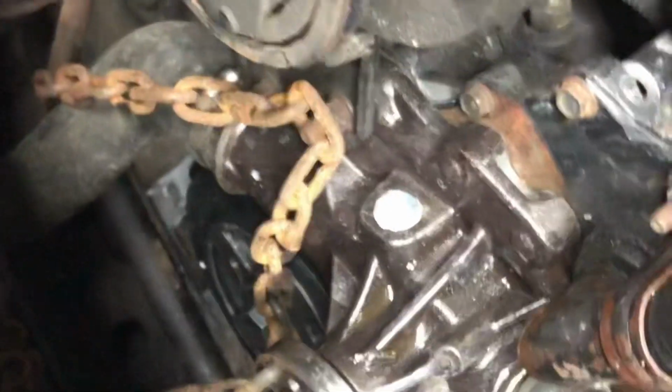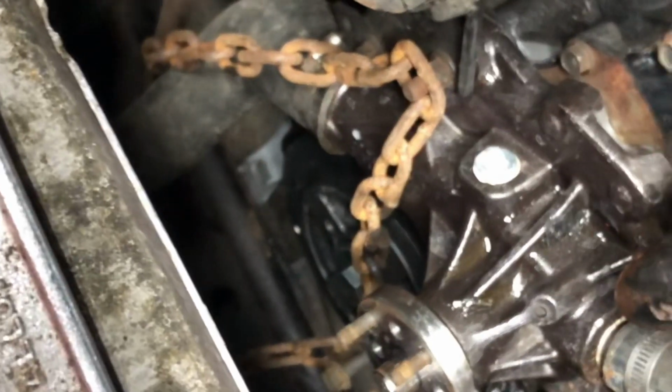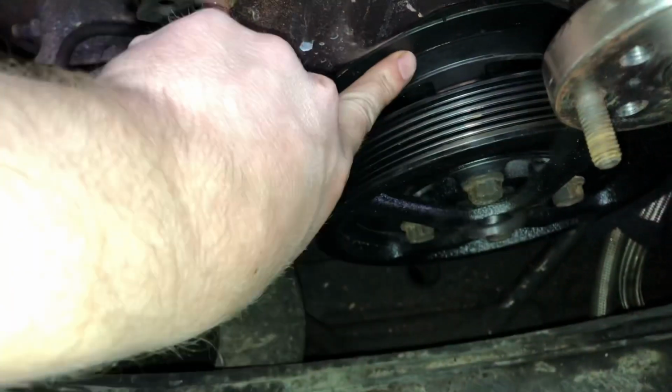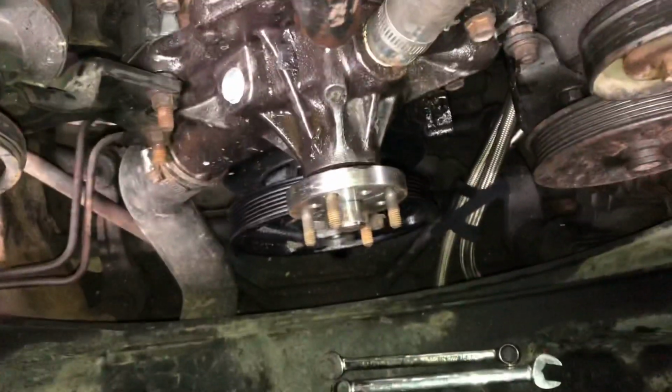Choker chain is on. And all I got to do is torque the new balancer bolt to 200 foot-pounds, 185 foot-pounds. And then I'll install the new pulley and get this thing put back together and we'll fire it up. Okay, so here's our balancer. He's in our truck. Use the pusher, put him in. Here's the new pulley. All 4 of these are torqued. They're 15mm heads. So, that said, it's all set up, ready to rock and roll.